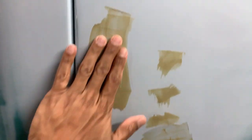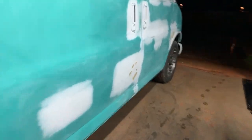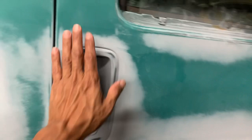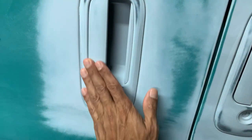We have to sand our glaze putty spots because we did have a little bit of pinholes and some scratching on the bodywork that I wanted to just quickly fill with some glaze putty. Not every area, but just some areas. We 2K primed up our door handles here, so it's going to look a lot smoother. And I could get in here a little bit more and sand this out a little bit more if I want to, right? Get it smoother. It's pouring out now.